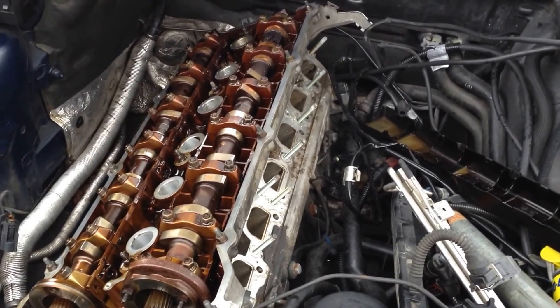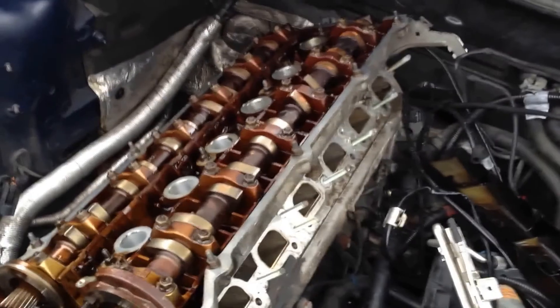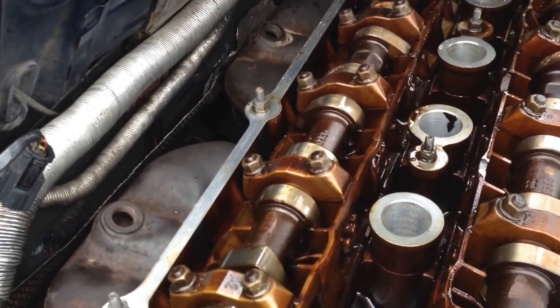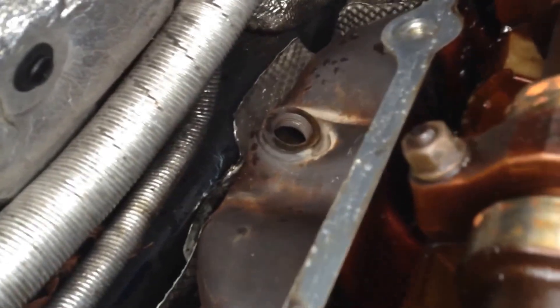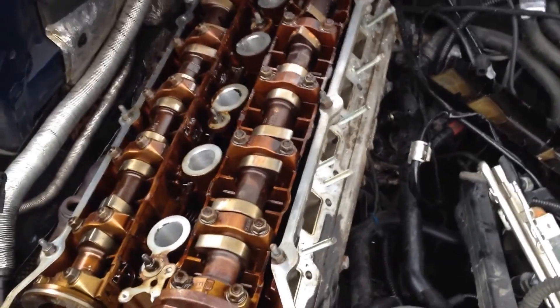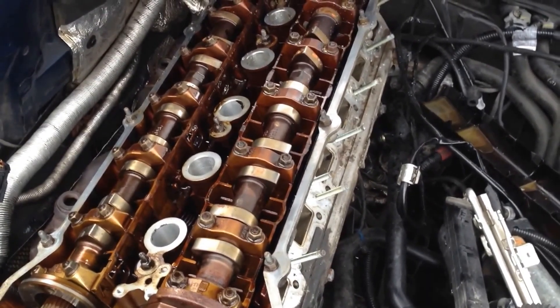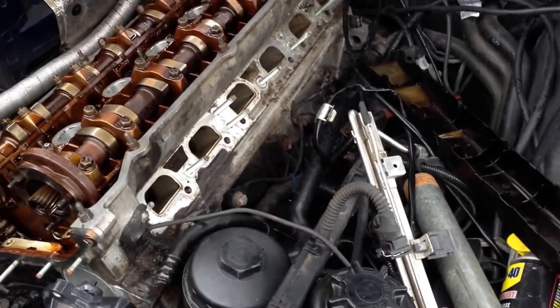So of course I didn't have any here. They're about $27 for the whole set. It's not that bad to put them in, actually pretty easy. The only thing that sucks about this car — on these 3 Series, I did not take off the collector, I took off the manifolds. So you can see right here I just have two nuts finger-tight on each one so they don't fall off. On these 3 Series cars, on the E46s, you can see how tight that back manifold is against the strut tower, or frame rail you might say. That makes these a real pain to put back on and make sure your gasket's right — you have to hook the exhaust studs down in there.